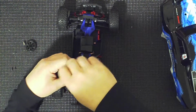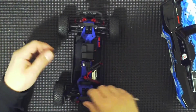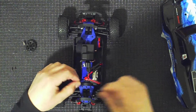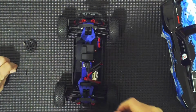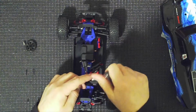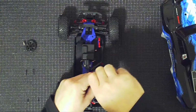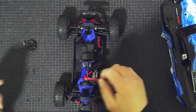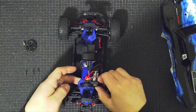So right now I'm taking this apart because it stopped running. So this still turns. So I'm going to check the gears. I'm pretty sure he stripped the gears. If he did not strip the gears, then he probably fried the motor, at which point I'll test the motor. Because the motor is a direct current motor, DC, it's very easy to test. You just take a battery, plug these two terminals in, and you're set.